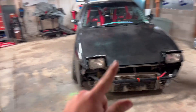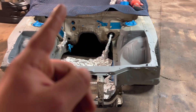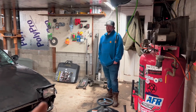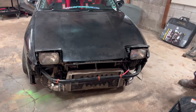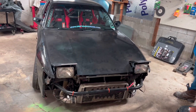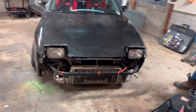Unfortunately we're not going to work on it to make it better — we're actually going to start removing stuff. This motor is officially going into this car. I know this was going to be the Japanese Corvette, but I truly think the LS just deserves to go in there. Do you approve? We're going to take the hood off, disconnect the drive shaft, disconnect the shifter, drain the coolant, and remove the intercooler piping.